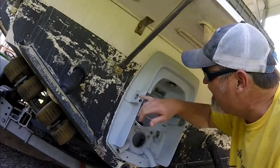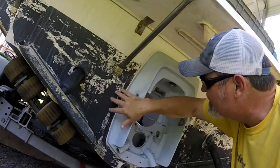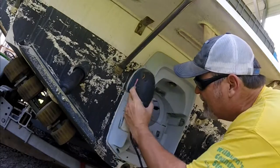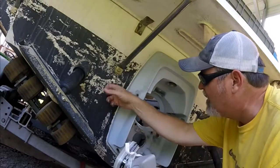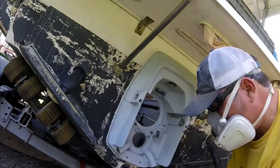As you can see, I've got some bottom paint here that's going to kind of get in the way. When I go to clean and degrease it, it's going to pick up this old bottom paint that's flaking off. So I'm going to try to use this hand sander here to knock it out of the way. You always want to wear some kind of respirator when you're dealing with removing old paint — you don't know what's in there, it might be harmful to breathe. So I'm going to put on this respirator.